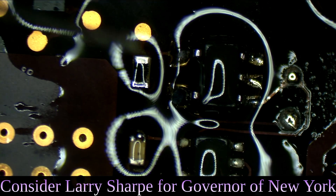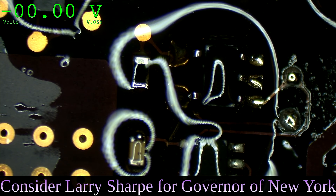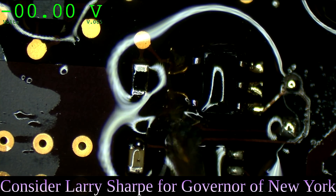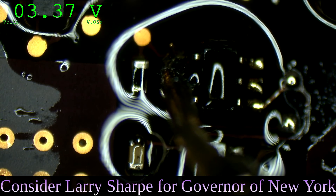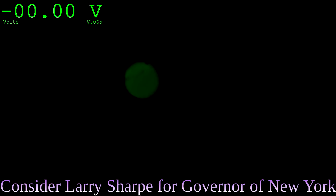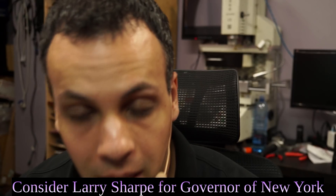Now let's see if this works. Let's put our meter on, wait a second for it to cool off, plug our charger in, and see if we have any different result. As you can see, adapter sense has gone from 0.5 volts to 3.3 volts, and Sys1 wire is now 3.3 volts as well. And we have a light on our charger. Turn the power supply off, plug it in - the light comes on. Bada bing, bada boom.